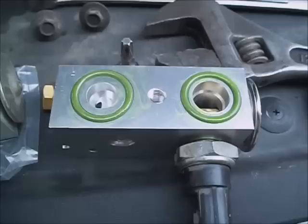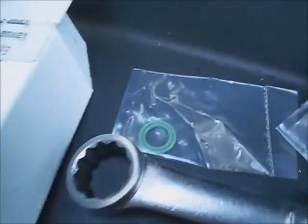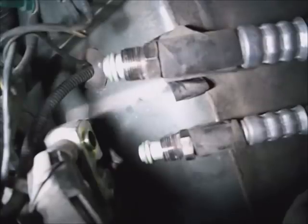This cap plug has an O-ring on it and I'll change the O-ring on it. Worst case, if you don't have PAG oil of the right viscosity, you can get some oil off the old TXV valve and put it on the new O-rings as long as it's clean. New oil is installed on the O-rings. Now I've just got to switch the line O-rings and oil them up with PAG oil. The new O-rings are oiled up and stuck on the lines and the block.